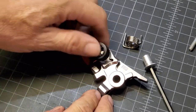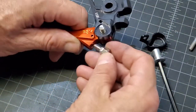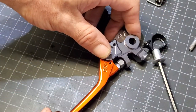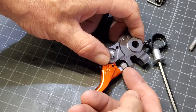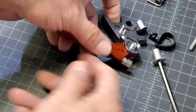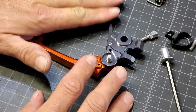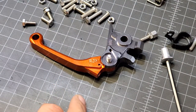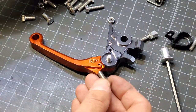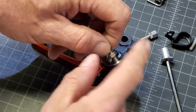Now, I've test fit this. I'll loosen this up and take this little plastic piece out that covers the spring. I've test fit this and this is the stop point when you're pulling the brake lever. To make me happy, this is still not short enough. If I take that nut out, it could get close to short enough, but then I can't tighten it and it will move. So this morning I went over to the hardware store and got a selection of bolts — metric, M5 with a .8 pitch. The ones I like are just these round head ones; I don't have to really do any work on them. I went ahead and got stainless nuts — I always like stainless.